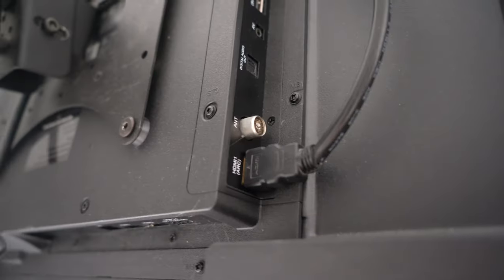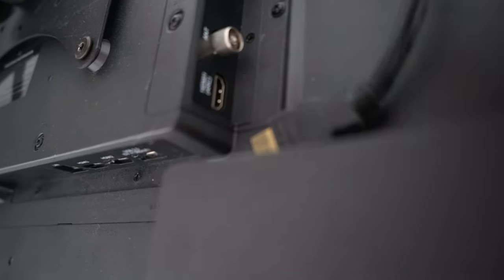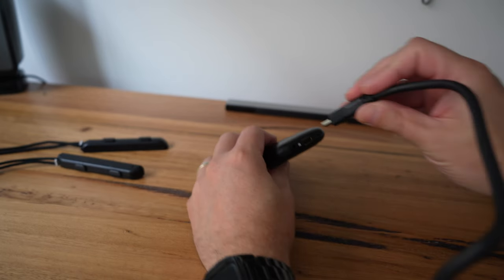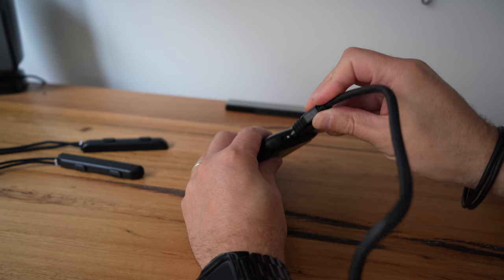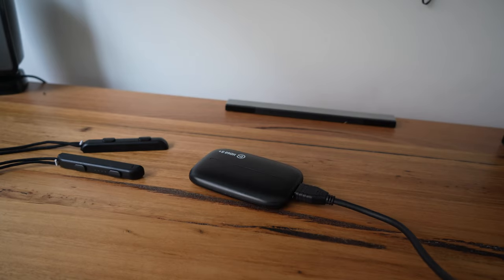What you're going to need to do is capture the video stream coming out of your Nintendo Switch into the Elgato device. So you're going to unplug that HDMI cable from your TV — the cable running from your Switch dock into your TV. Unplug it from the TV side and run it into the port that says IN on the Elgato device. The Elgato device has two ports: IN and OUT. You run the signal IN from your Switch.